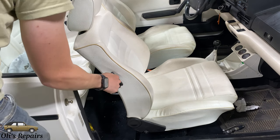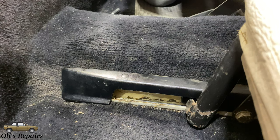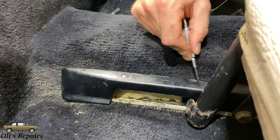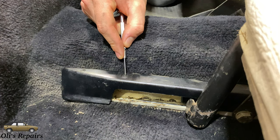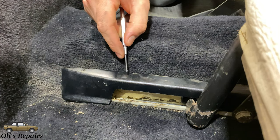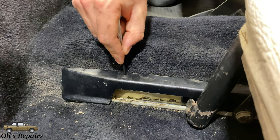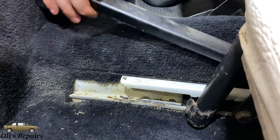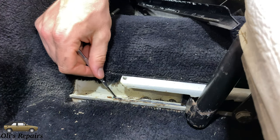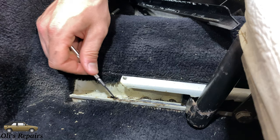With the front bolt removed, fold the seat forward. With the seat folded forward, we'll now be removing the seat rail cover. To do that, you need to remove this little plastic rivet that's holding it in. Grab a screwdriver and push in on this little center piece to push this little plastic piece through, and then you can just pull it up, remove the seat rail cover, and don't forget to retrieve this little plastic piece that we just pushed through.